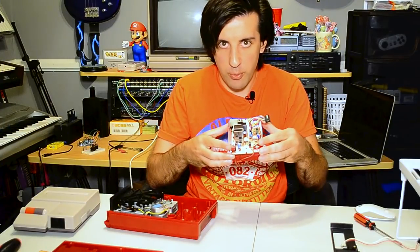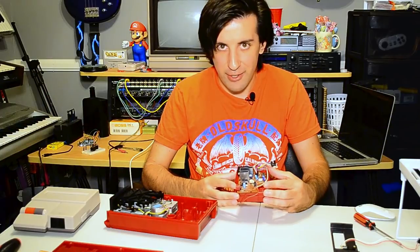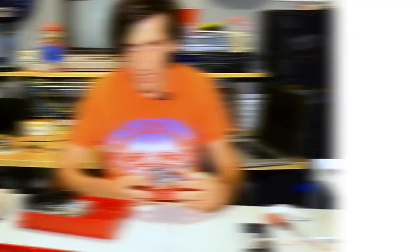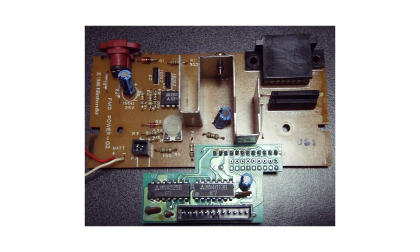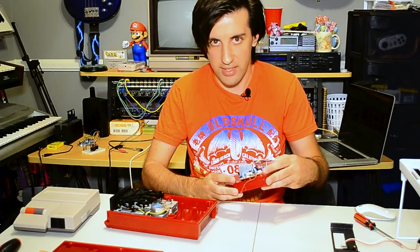Let's take a look at this power board I just removed. Down at the bottom it says FMD Power 05 — that's because there were actually five different revisions of this board. Each revision has the exact same functionality; the only difference was how it implemented copy protection. Version 1 and 2 had absolutely no copy protection — that version was awesome. Version 3 and a later revision of 2 had a little breakout daughter board: all you had to do was remove it from the connector and you were done. Version 4 and 5 is where it gets tricky — they put the ASIC directly on the board so you have to run some wires to bypass it, and the bypass is just in slightly different places between those two versions.